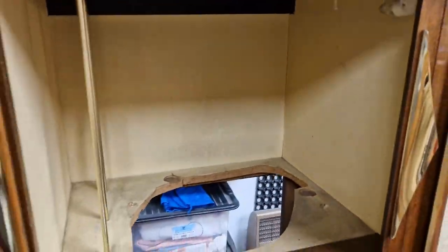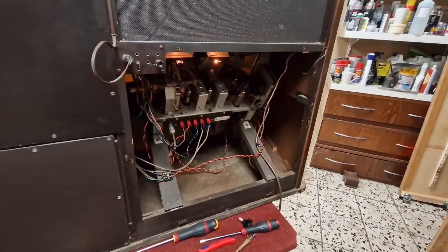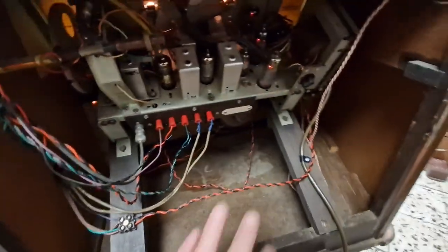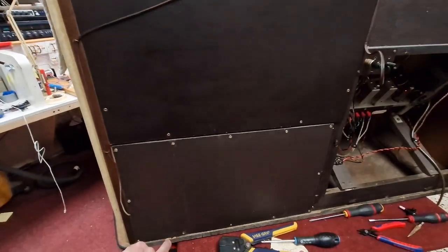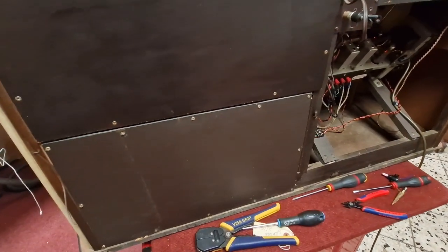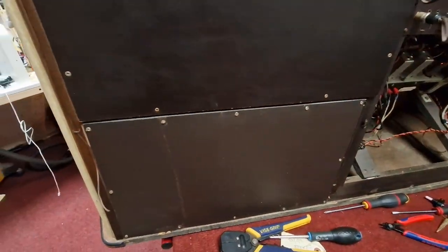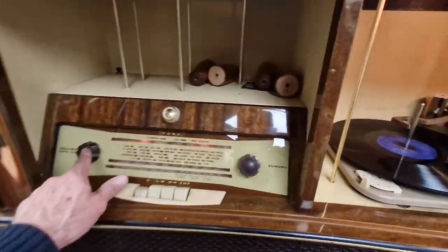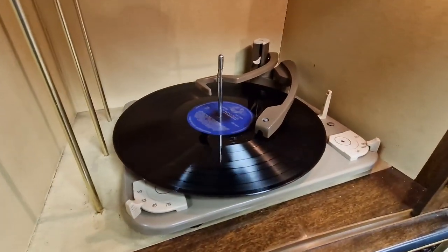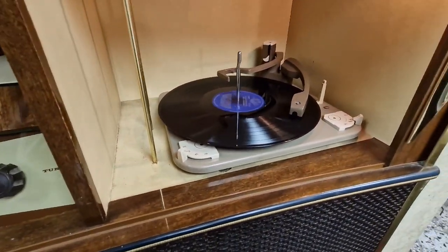All we've got in here now is a great big hole where the deck used to live. So I've got it on the bench and I'm going to get that back in there. The chassis is back in and I've added some extra cable restraint. There is some fitted cable restraint already, but I've added an extra piece before putting the back on. The back is now all nipped up nice and tight with new screws. I've added extra screws to this bottom section because it's started to bend slightly over the years where it got damp. The final thing I've got to do is fit the original knobs, and the deck is in there whizzing round — looking lovely.